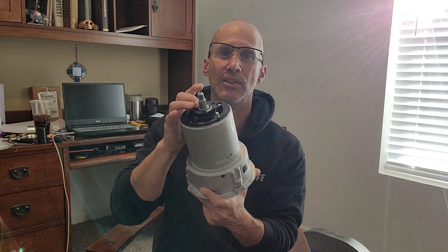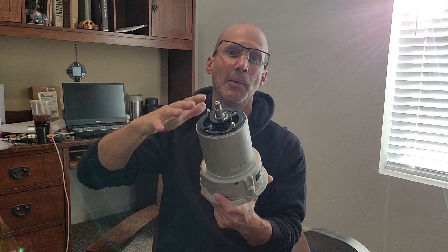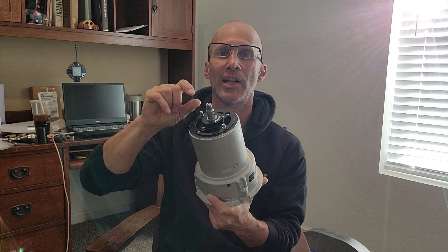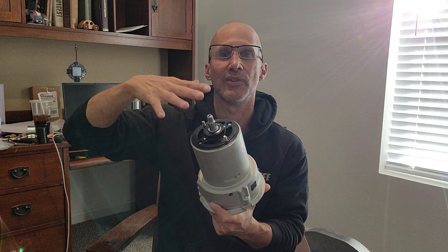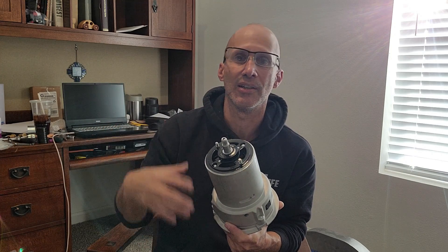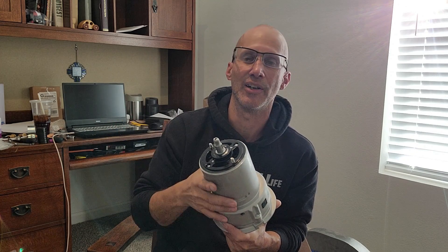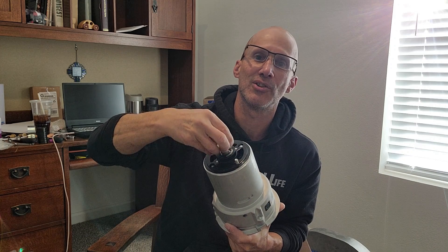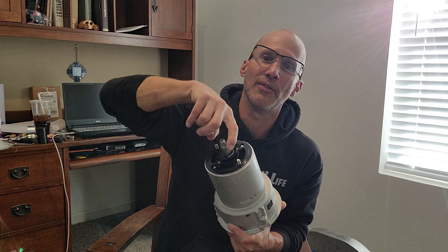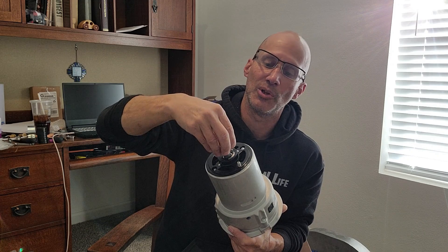The reason I made this custom spacer is that on many alternators — whether Bosch, Compufire, MP, or whatever — the height of the original spacer was different, which made the tolerances for fans quite wide. I didn't want you doing spacers, shims, and trial and error, so I made my own spacer. On these Bosch alternators you might find little ridges at the Woodruff key slot. With the Woodruff key out, take the old spacer out, put this one in, and you're good.